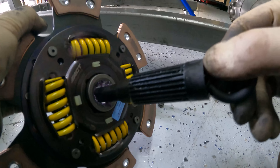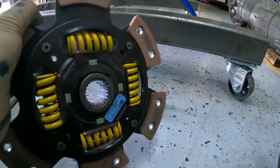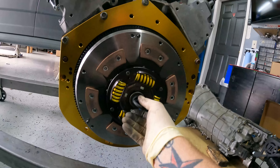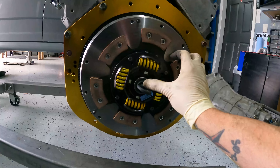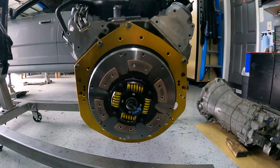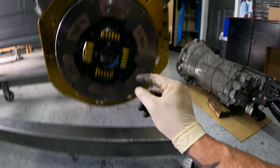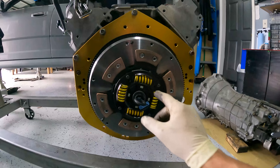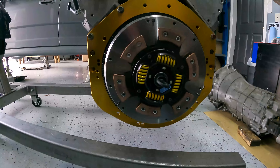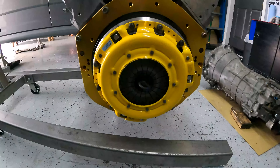You can see I put some of the grease on there. I'll use the spline tool and put it on — I can just move it in and out to grease the inside just enough. Even coating, and that should sit on there. I'm going to have to steady this a little bit — if I let go this might fall off. Actually, perfect — that'll be enough for me to undo this, set this on here, have the bolts ready so I can put a couple in to hold it all together. This will keep it centered, and then we can tighten them all around. Then this is going to be ready for the transmission to mate to its new home.